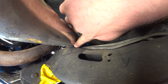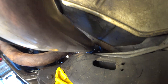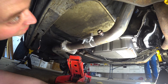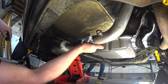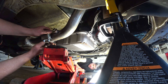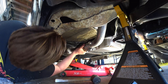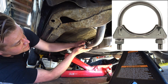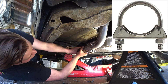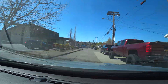We're rubbing on the frame there — I don't know what we need to do. It turns out the test pipe, which has that expanded length that slips over the downpipe, is probably not meant to be used with a U-bolt type clamp, and that's what we had used previously. The U-bolt type clamp had pinched that thing closed, so it wasn't expanded to its full diameter anymore. That turned out to be the problem. So we took that pipe off and headed over to the local muffler shop.